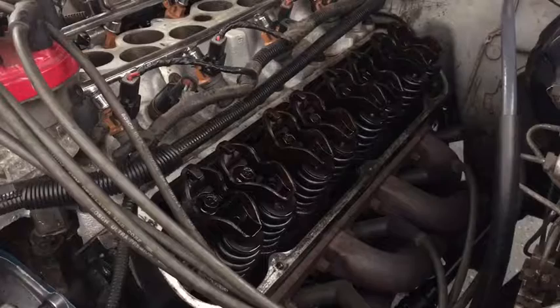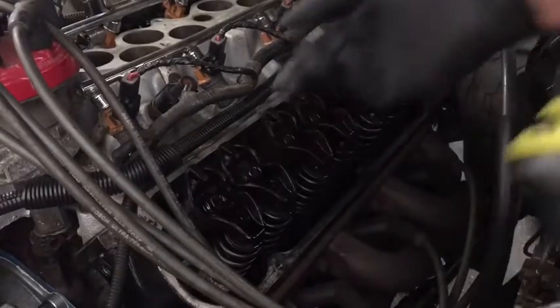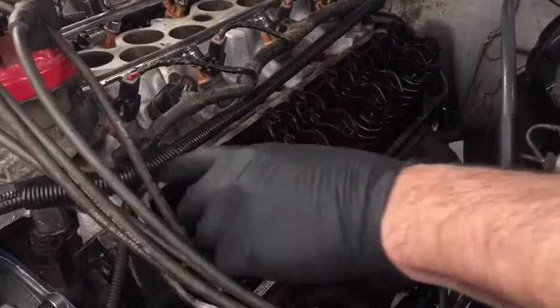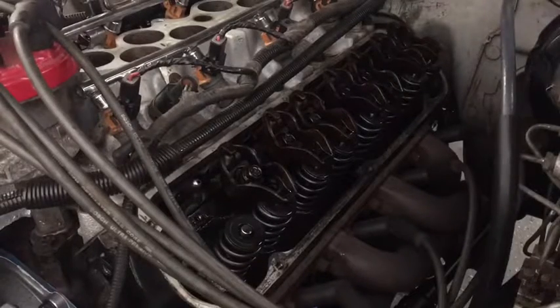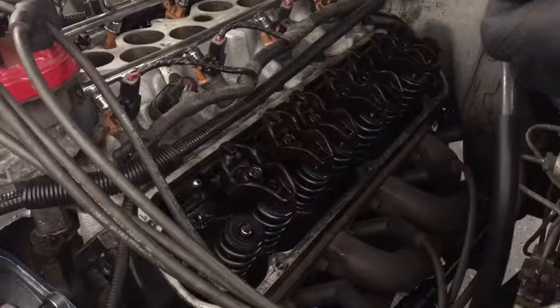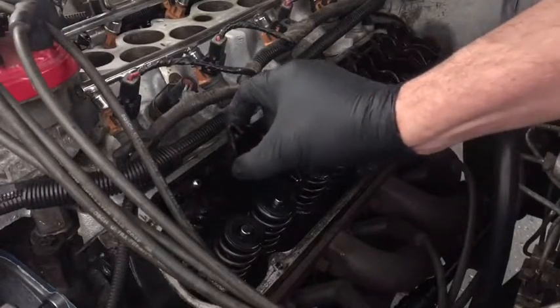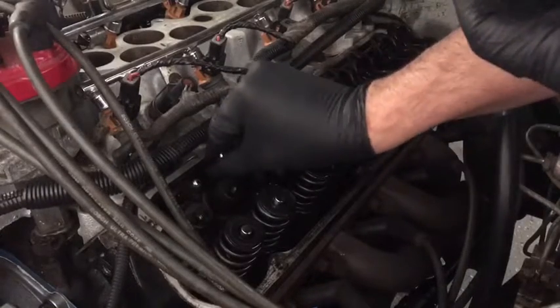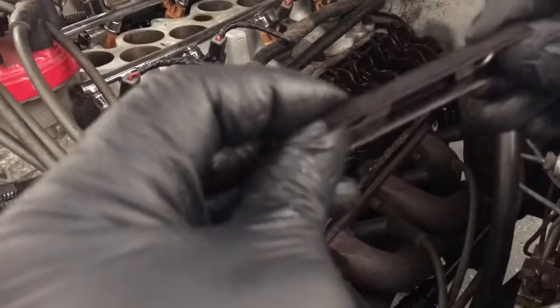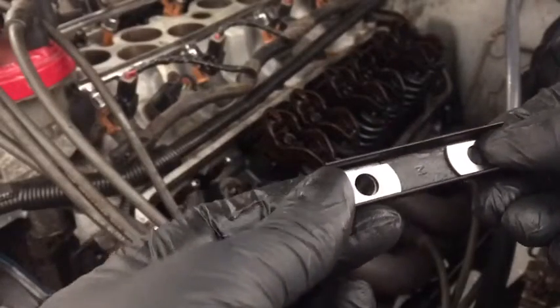Not very technically accurate, but nothing in that motor is. I'm going to give it a shot. I know this is not the best way to remove rocker arms, but I've already loosened them up, just so I can do this quickly. I'm going to pull these two off, one at a time. Right down there — this little valley here is where you put the shim. I'm going to actually pull both of these off. Make sure that's down in its lifter. If you shimmed it up enough, the little square rocker piece there would still drop in enough to align the rocker arm, but for these I don't really think it's going to matter.